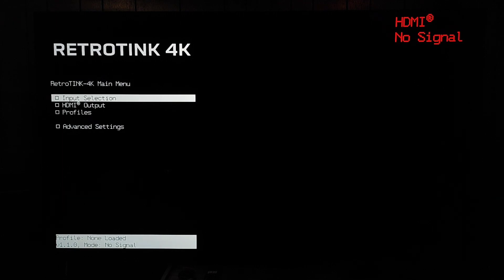That's how you update the RetroTINK 4K. Now that I've done it, it seems pretty simple, but it took me a long time to figure out. Hope this video helps someone out. To reiterate: I definitely recommend the reset button method — it was a lot more reliable, especially going from 1.0 to 1.1. Just replace the two files from the zip file in the root directory of the SD card, then hold down the reset button when you turn on the RetroTINK 4K. Thanks for watching everyone, bye!